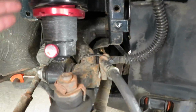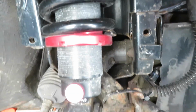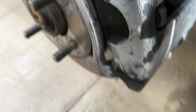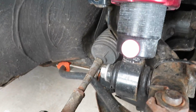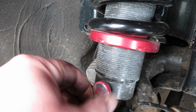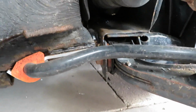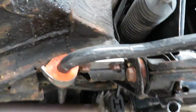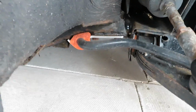So as you can see, there's the coilover, which are made by AVO. Pads don't look like they've got much life left in them after Cadwell Park. These coilovers have got about 20 points of adjustment for the damping, something like that anyway. Down here you can see the front GTI anti-roll bar, which I bought stainless brackets for. Also polybushed, as you can see there.